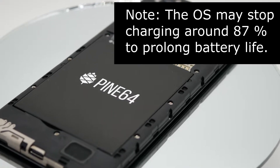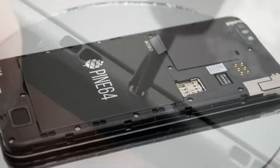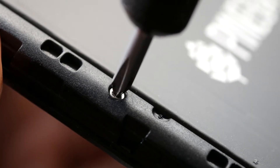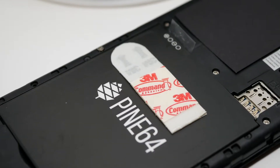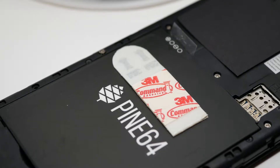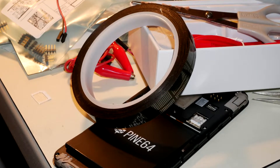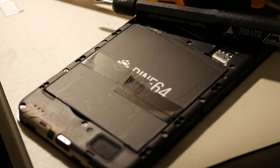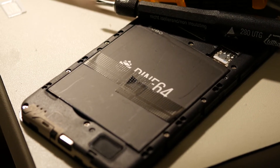For me, this is where I ran into trouble, because the battery was completely wedged into position, and even when I followed the wiki by removing the four screws, which might work for some people, the battery was still stuck, and I could only remove it by using double-sided tape and lifting it out with some considerable force. Since I don't want to do that every single time, I took a strip of anti-static tape and wrapped it around the battery so that next time I can simply unpeel part of the tape and pull the battery out of position.